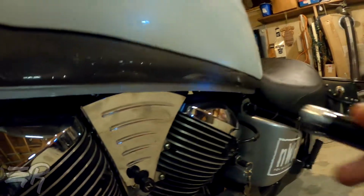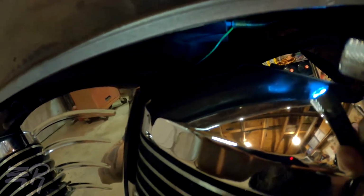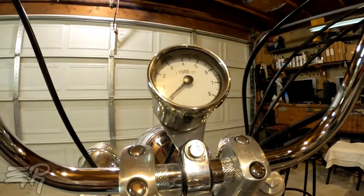And you can see these red and green wires tucked away and coming down, and that's where my green wire leads to, right in there. I have the bare wire sandwiched in between that blue and yellow there. What I did was I took it out, and then I just fed some of that copper into the end and sandwiched it all together so it won't go anywhere. So it's going to give signal to the tachometer. And I didn't have to tap into this wire because it'd be a big pain to tap into that wire and have something go wrong and your bike not even be able to get power or even start.